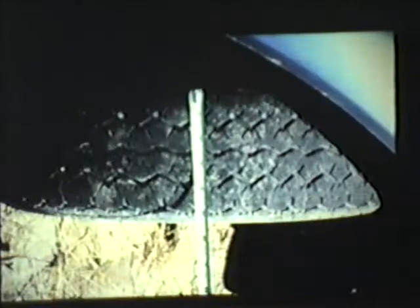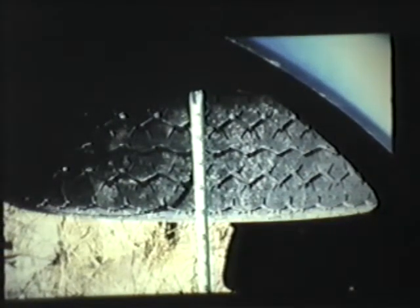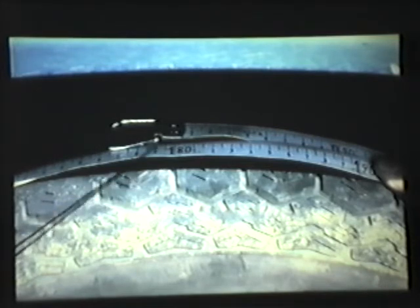Now, after we're finished, what I'd like you to do is measure the vehicle. We'll measure them after, not before. Measure center to center for our wheelbase, and then we're going to measure our track width. So right there, 2.4, go right to the center of the hub. It's going to be close, not perfect, because if the tire sidewalls are bulging out a little bit, or the tape might not be perfectly straight. That's just a slide of somebody taking the measurement for the tire. Once again, when you run a tape right around for the circumference, expect it to be a little bit longer than your test impression.